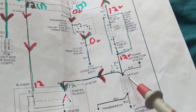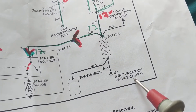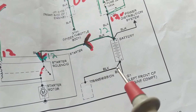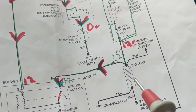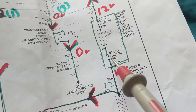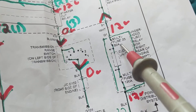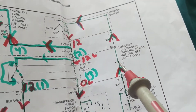Starting from the battery positive terminal, the negative goes to G1, which is the left front of the engine compartment, and also to the transmission housing as ground via black wires. Current flows into one multi-fuse — that's a big 120-amp multi-fuse — and comes out through the other multi-fuse, which is only 50 amps.